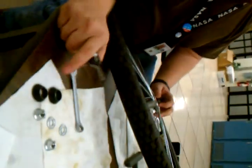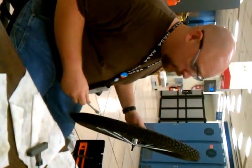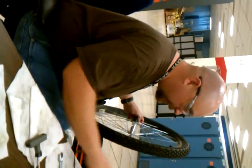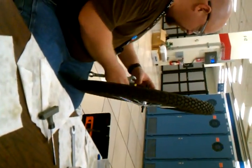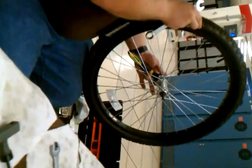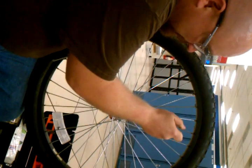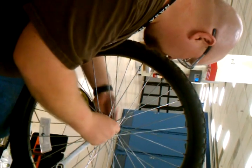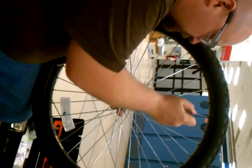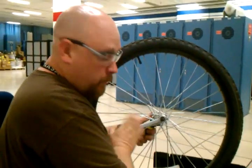Yeah, that's to keep the dirt and water out. Now, something you learn, always try to use the right size wrench. Right now we're going to be dealing with a 17 millimeter. And I'm going to put an adjustable wrench on the back side simply to hold the axle, but it's a bad habit to use adjustable wrenches to do the entire job. And really all you need to do is break over. I'm not going to have an easy breakover this time.